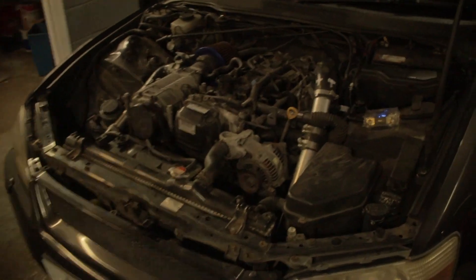Back at the workshop — we've made some reasonable power, 237 BHP and 307 Nm, good enough to drift. If this engine blows up, so be it. It's one of the worst engines Toyota has ever made, together with the 1ZZ. It is quite lean, but there's no real way of controlling the fueling unless you go standalone, because it hasn't got a fuel pressure regulator or a return line. The ECU does relearn, so you can't really map it unless you go piggyback. Just leave it — if it blows up, it blows up.